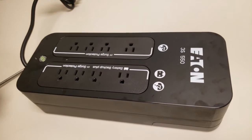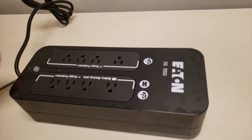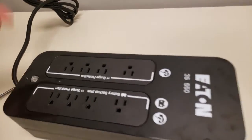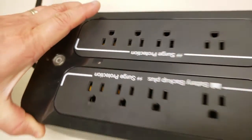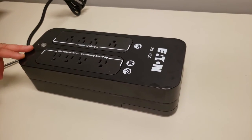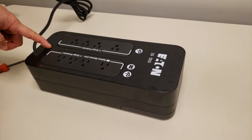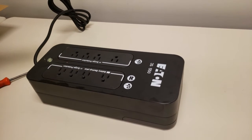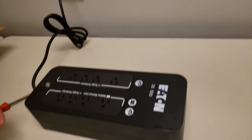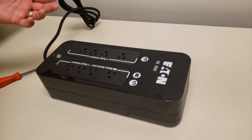If you come in in the morning and the UPS has been beeping and then died, you'll notice it will not have a light on. That tells you the power going to the UPS has been shut off, the battery has completely drained, and the UPS is not turned on. When you come back in the morning or hours later, hold down the power button again until it beeps and let go to power it back on. As it's connected to the wall, it's recharging the battery the whole time, so once it's back on you can power on your devices and everything will work fine again.